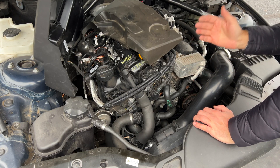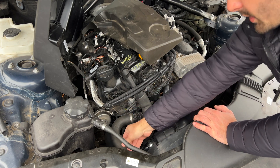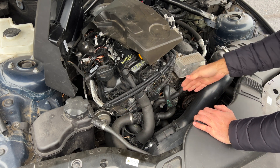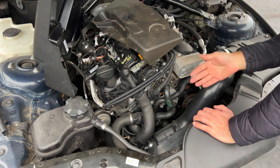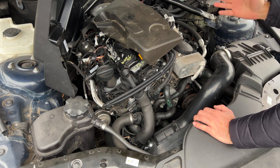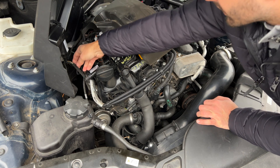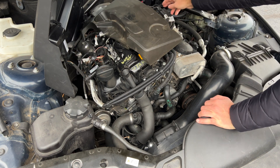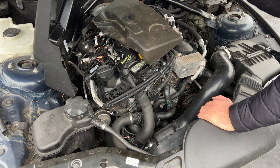As these engines are becoming older, it's also a good idea to check the coolant hoses — you have a big one here and here and some return lines — they should be checked for cracks and make sure none of them are leaking. Also make sure that the charge pipe is not cracked and inspect the vacuum lines. We have the charge pipe right here and the vacuum lines — there's one here, one there, and a few here in the back that go to the vacuum pump. All of those should be checked.